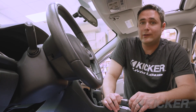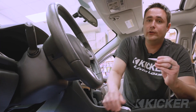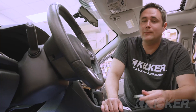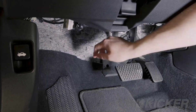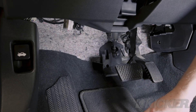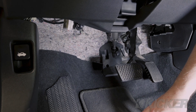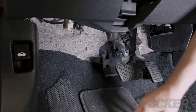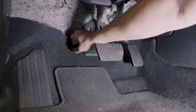If you can't find an acceptable OEM grommet, you do have to drill your own hole through the firewall. The tool I'd recommend is a unibit — a step bit. The reason you use a step bit versus a regular drill bit is that once you breach the firewall, you don't go racing all the way through and stab something inadvertently on the other side. When hunting for the ideal location, look for common reference points on both the passenger compartment side and the engine compartment side. Great places to look for are manual transmission knockout plates on vehicles that came with a manual transmission option but aren't currently equipped with one — pull the carpet back and look for the firewall behind it. Then drill your hole, snap in the plastic 4-gauge grommet, and run the power wire through.